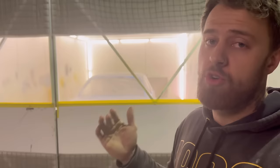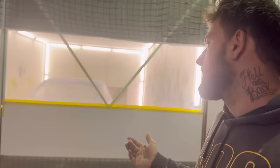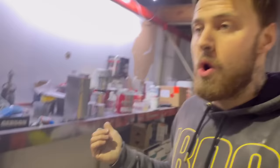So tomorrow morning, first thing, a quick 600 wet rub over the primer. But obviously, the better it lays on, the smoother it is, the easier the job's going to be tomorrow. So this is really just going to be a nice sealer. It's going to take care of all the rub throughs where I've gone through the primer and hit the filler. And boom, so let's do that. So again, like I said, just a normal HS primer, normal hardener, but just reduced to about 30-35%. So let's get it.